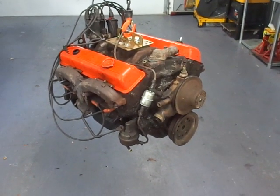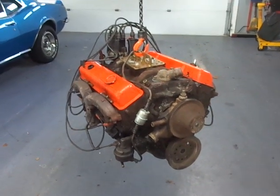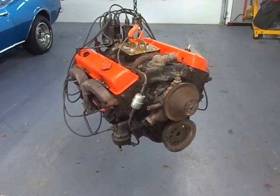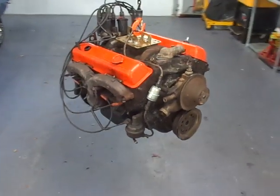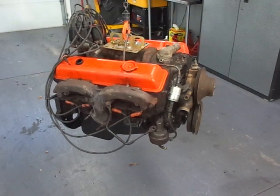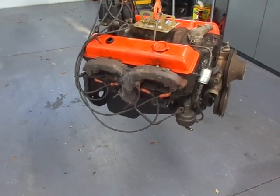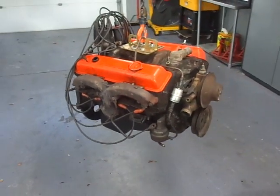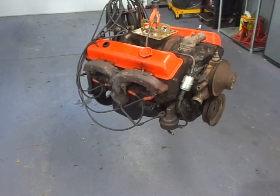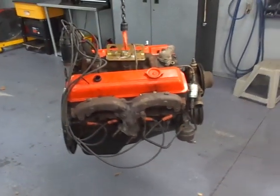Until now, because we're going to make one. This engine is the original from the '69 Chevy truck. It got taken out this morning — I just went and picked it up — and it's pretty grungy looking. We're going to power wash it, clean it off, strip it down, and see what it needs. I want to give my customer a choice between rebuilding it exactly stock with the two-barrel carburetor and cast iron manifold, or adding probably a hundred horsepower. The 307s had less than 200 horsepower back in the day, and it's possible to get 300 horsepower and still be very streetable.